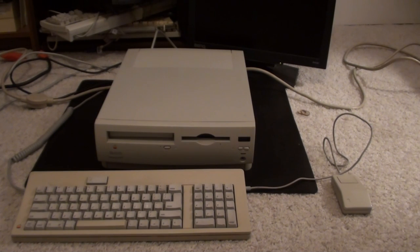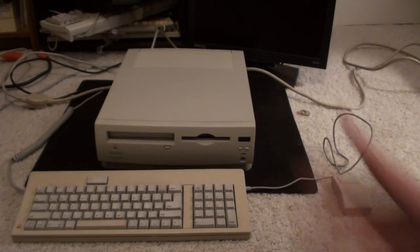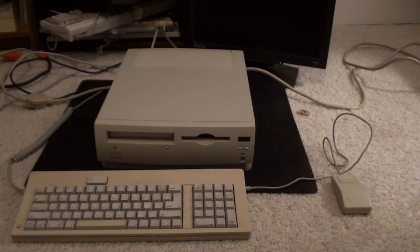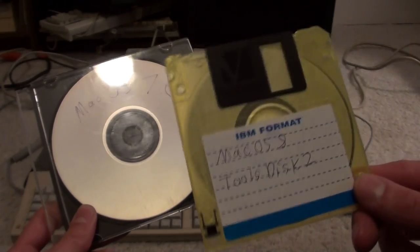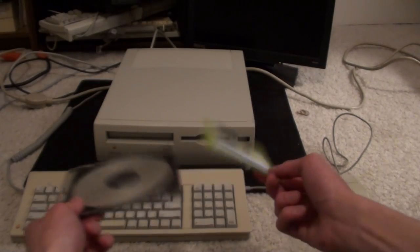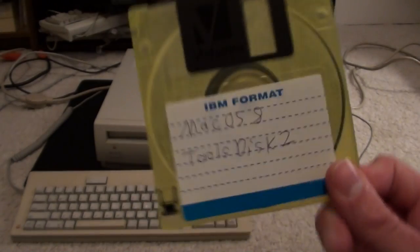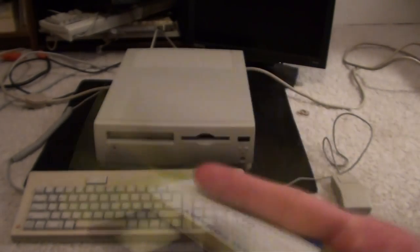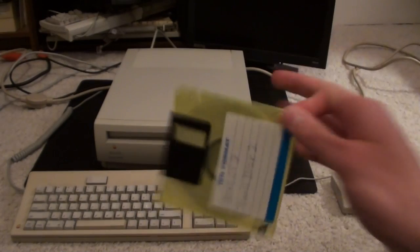We've been doing a lot of model-98 videos lately, and this machine's model identifier is 98, so I guess we're still fitting with the theme. To save you guys a lot of boredom, I've already put together the two things needed for this install: the Mac OS 8 Tools Disk 2 for booting, and Mac OS 7.6 for actually installing the operating system. These took five hours to create because I went through probably countless rewipes of a floppy disk to figure out which image actually worked. It was a nightmare.